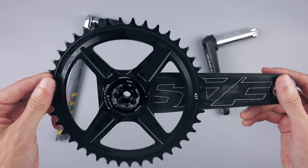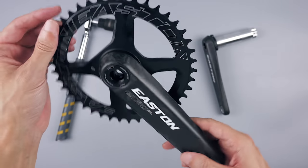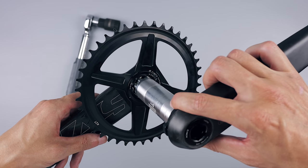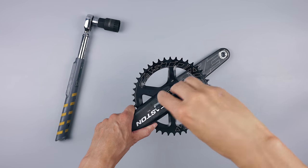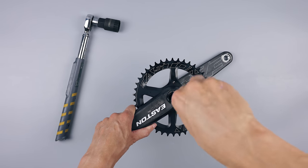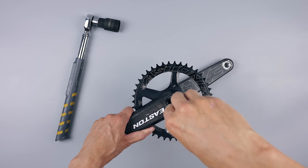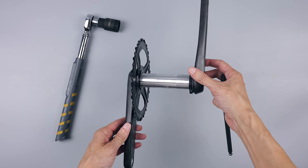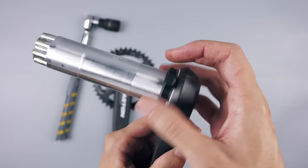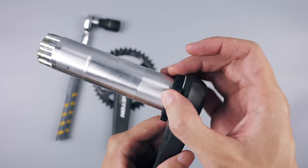Also mounting this in a frame — you mount it on the opposite side from the Shimano crank. You thread the non-drive side in, and then the only thing you need to attach the drive-side crank is an 8-millimeter Allen key. Torque it down to 50 newton meters and the crank should be in place. After that, the only thing you need to adjust is the preload collar on the non-drive side. I will go more in-depth on that part once we start building up the bike.